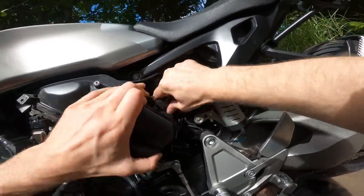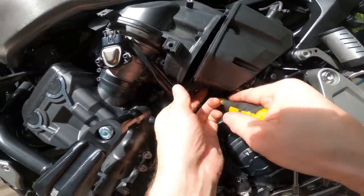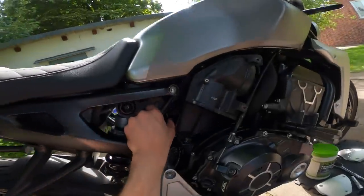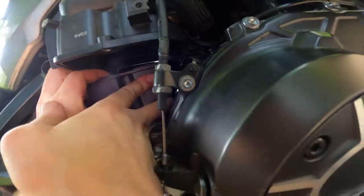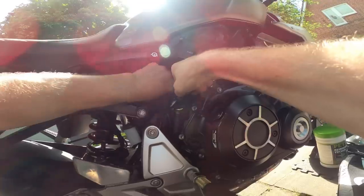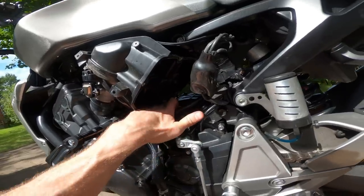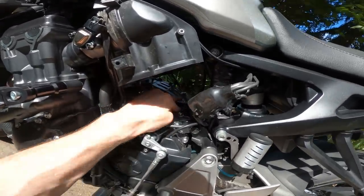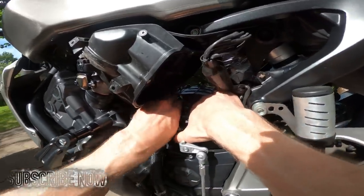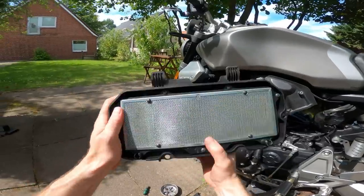The wiring loom is right in the way. Using a screwdriver to push the wiring out the way - sorry if you can't see, this is all happening keyhole surgery style. The key is to push this wire forwards and these wires downwards. Honestly, all of that wiring could be better laid flat either side of the bolt so that none of it was an issue, but that's not how Honda plays. Anyway, the airbox is out and we can put the new filter in. Sounds like it's stopped some rocks already - I've come over to the shade for this part.